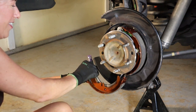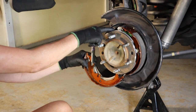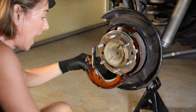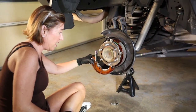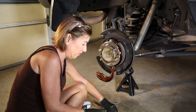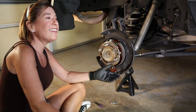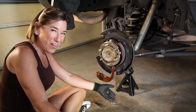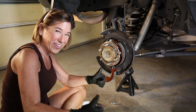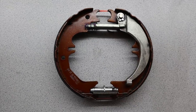Making sure this spring is pointed up, you're going to have to hold on to everything while you put it on, because it fits in a special slot built for it. This spring is going to go on to the other pivot point. For now, leave the adjuster aside. Just a warning — this is a super frustrating job. There are going to be a lot of swear words; you may scare your significant other and/or dogs. But I have faith in you — you can do it.